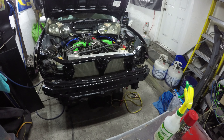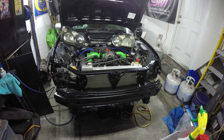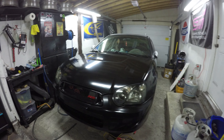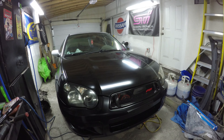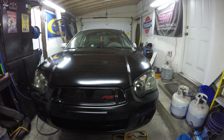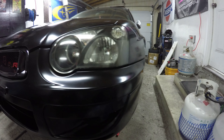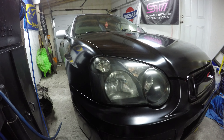I'm going to fit the grille in and get the horns installed - and there you have it. That's my Bug Eye WRX with a converted blob eye front end. All the parts are from that old red RS, repainted black. It kind of turned out the way I expected. I did get the headlights a lot clearer - did another buff job and hit them with about three coats of clear coat. I'm hoping that resists further yellowing, and maybe if I buff that clear coat later they'll clear up even more.